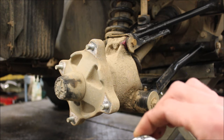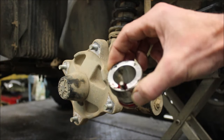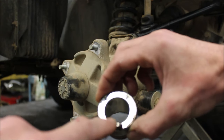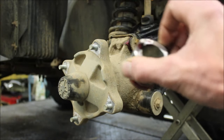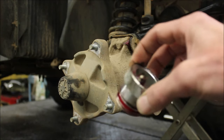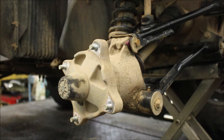And here's the wheel bearing greaser that I bought. I was told from a subscriber that you should buy the wheel bearing grease kit with the grease zerks on each side, because otherwise only one side will get greased up, or spin it while you're greasing it up, because grease will only come out on one side. So I've done this once before, and I'm gonna show you how I do it.